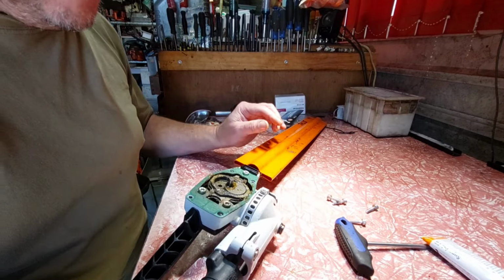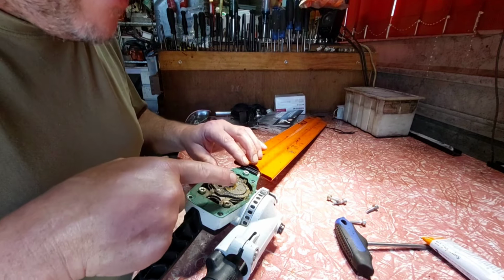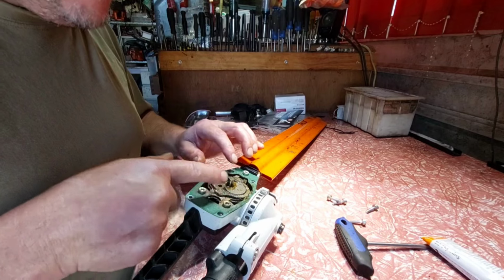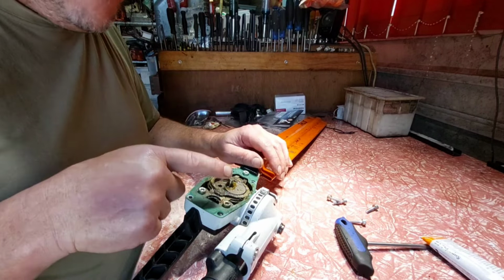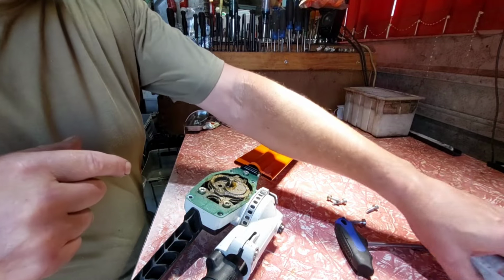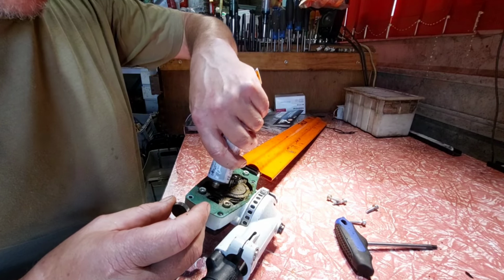Yep, she's dry. That's dry. So I put grease through just there. There's no grease on the other part, it's all dry. It's been hot just there and hot just here. So, yeah. Take your lid off the back and lubricate the back that way. That's terrible. It does not have to be full, but really it should have grease on everything that moves. And this here moves like offset, and that throws everything back and forth. So I'll grease her up. Not berserk, but I'll give her some grease because that's terrible.